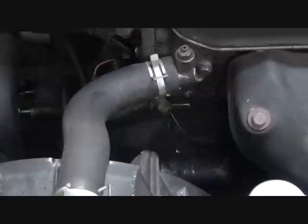You may have to have the engine tilted down on the passenger side a little bit. But again, the alignment between the transaxle and the engine is what needs to be straight. That alignment needs to be correct. Then once that's mated together and those bolts are snug and torqued, those are a 17 millimeter socket that's used on those bolts, and it's 50 foot-pounds of torque.